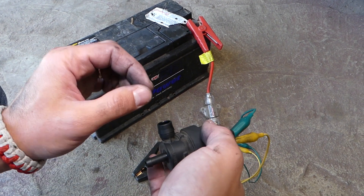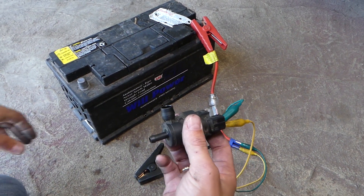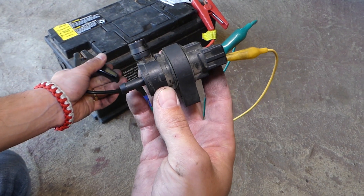They can be a little bit longer so I can show you and attach this one to the battery a little bit easier, otherwise I have to hold it with two hands. Now, when you connect the alligator clips to the battery, you're going to hear a noticeable click from the purge valve — listen now.